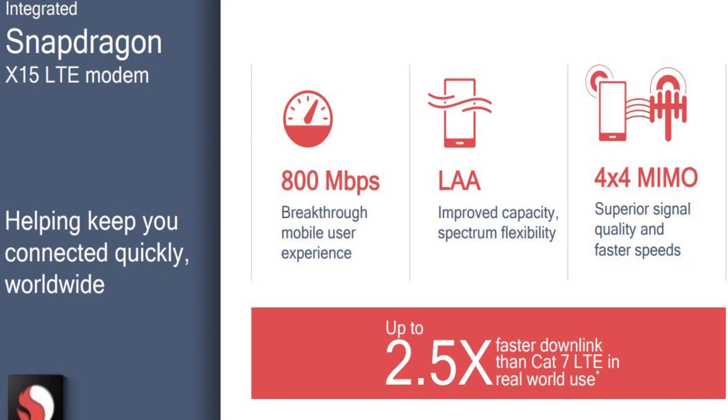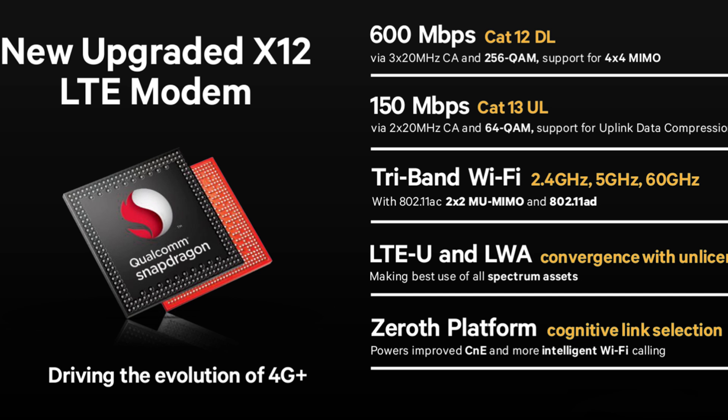What are the other really noticeable features of the Snapdragon 710? They've also put a better modem — the X15, compared to the X12 in the Snapdragon 660. The X15 now offers more LTE bands, higher upload and download speeds, and consumes less battery. Another big win, and this is all thanks to the chip shrinking down to that 10 nanometer process.